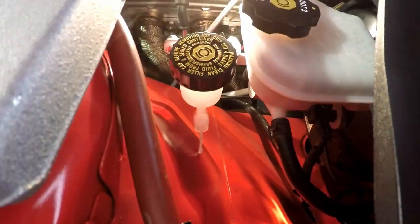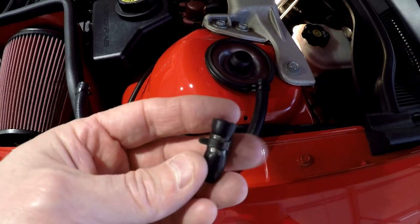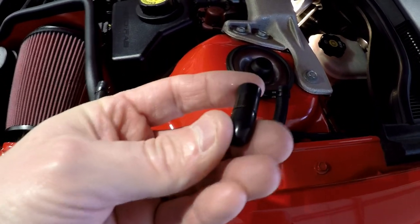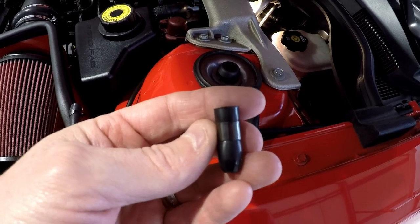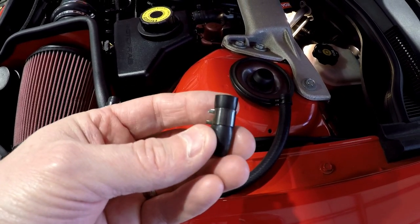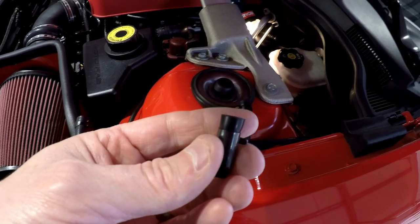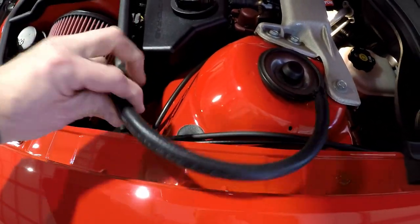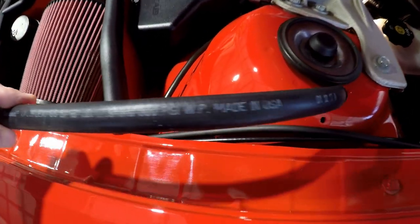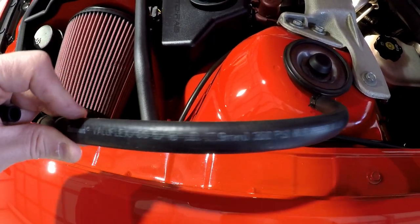They provided a length of hose and a cap — I'm not totally sure about that cap, but for now until I'm ready to bleed the brakes I'll use it. The cap should be EPDM rubber because regular fuel line rubber does not survive very well in brake fluid. As for the hose, it says 'Value Flex' — in other words, cheap junk.